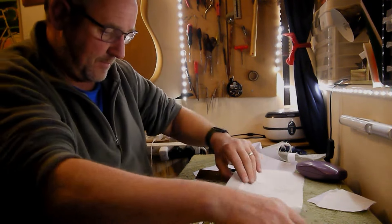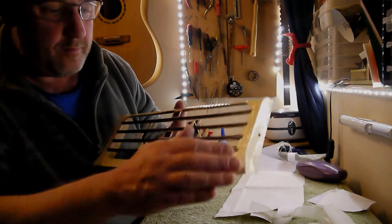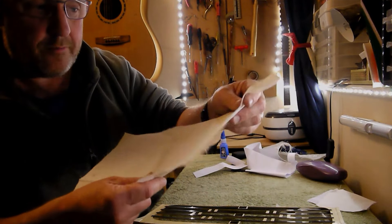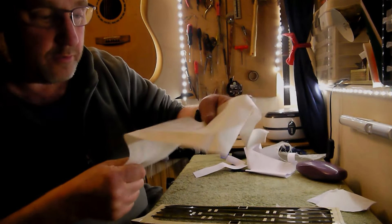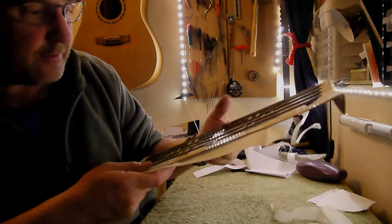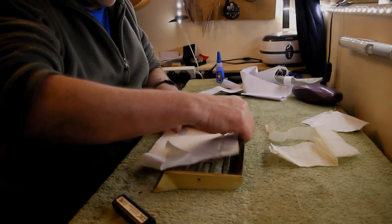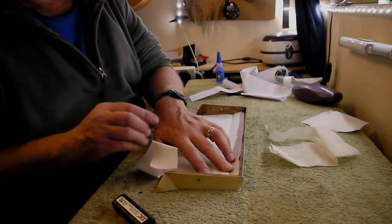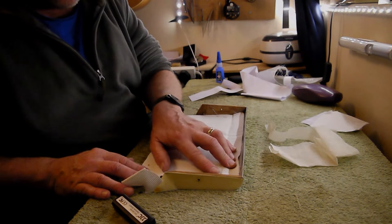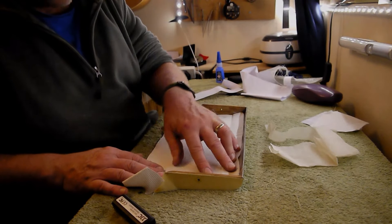It does look a lot better after a little clean — it just looks really nice. The next step is to get a grill cloth behind it, and I've got this cross stitch fabric which works really well because it's got holes in it allowing the air through, and it also looks really nice. I've got a little bit short in length here, so I'm going to cut one more little strip and carefully fix it, and hopefully it won't be too visible. I'll do some marking, cutting, and then glue.